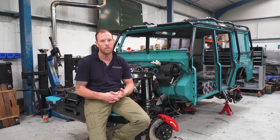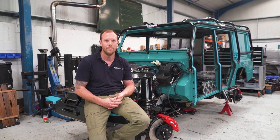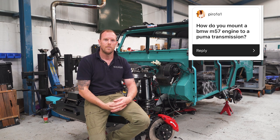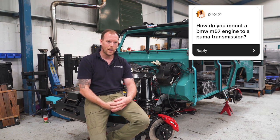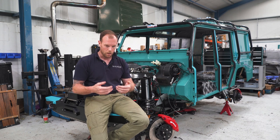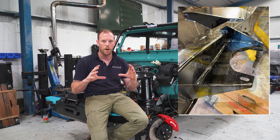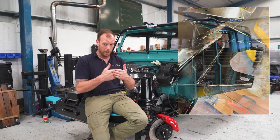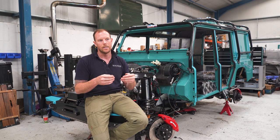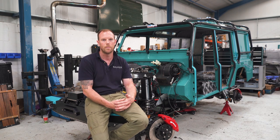If you want to throw £10,000 behind it, yes, it is an awesome engine on the Range Rover Sport. The TDV8 is one thing, but the TDV6 I would definitely not put in unless you want to be changing cranks regularly. As for how we mount a BMW M57 engine to a Puma transmission: we've made an aluminium ring — one side BMW, the other side Puma. We had a clutch specially made: the centre friction plate is Puma MT82 and the flywheel is BMW. There are some little secrets I won't share here, but if you want to buy a kit, hit us up on email or WhatsApp.